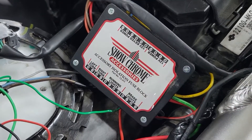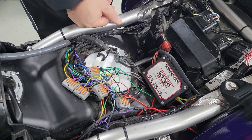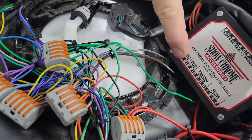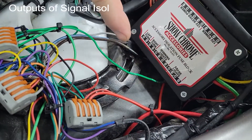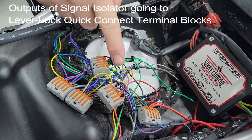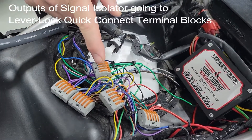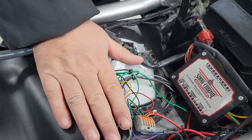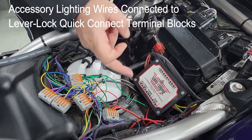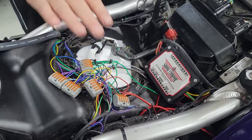In our case, since we've got so many lighting accessories hooked to it, we've gone and put a 16-gauge wire coming out from the left turn, right turn, running lights, brake, and ground, and they're coming to the lever lock like I just showed you. You'll see the ground wire here and then all my other grounds for the accessories are put in there. It's an easy way to keep things tidy — I'm not sure you could stick six wires into two different blocks, so this is positively the easiest way to go.